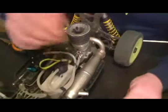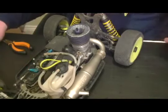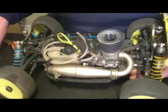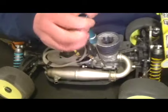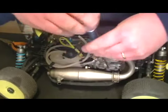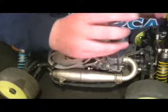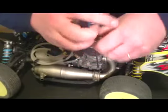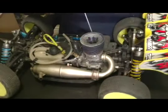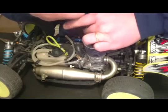We need to remove the front screw from the exhaust pipe, or at least loosen it up. Then remove the four mounting screws that hold the motor in place. I use the ball end wrench for this so you can get in at an angle — it makes it a little bit easier. Typically I'll leave the exhaust hooked up so you don't have to worry about damaging your exhaust gaskets, and it's pretty simple to take it all out in one piece.